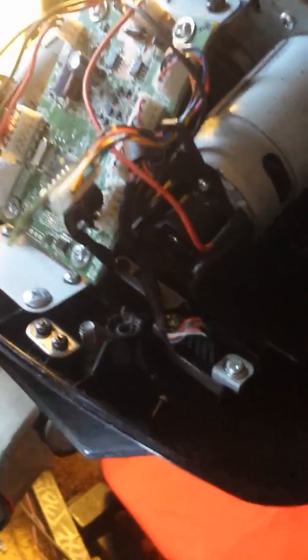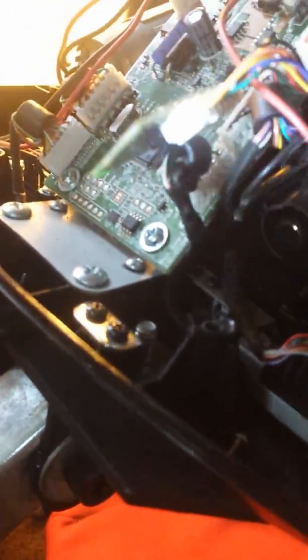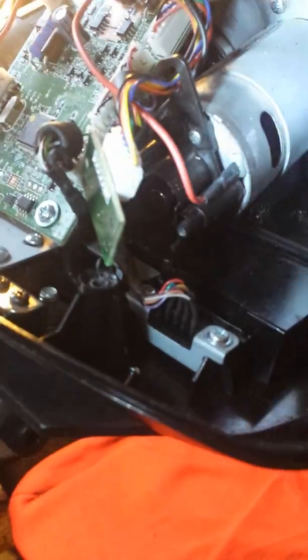Right now this is just for the Hall Effect sensor. Remember to clean that magnet and make sure everything goes back together the way you took it apart. This white plug will be closest to your electric motor — just remember that, and keep the wires from touching each other and getting tangled up. Hope you enjoyed the video, hope it was informative — subscribe.